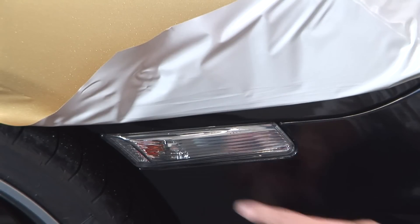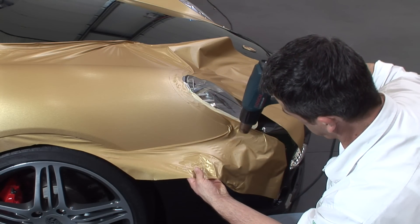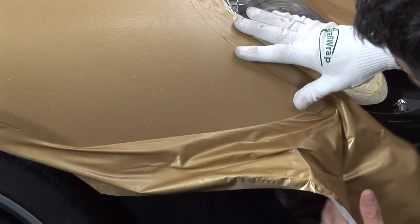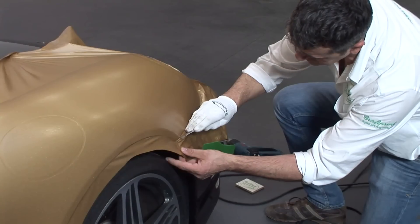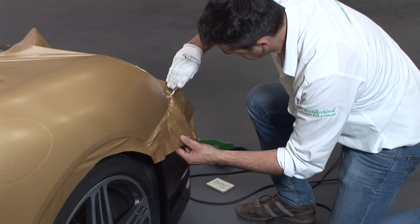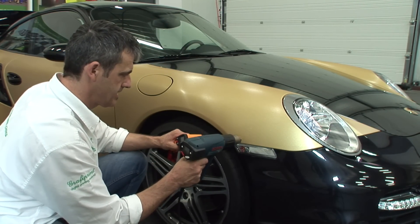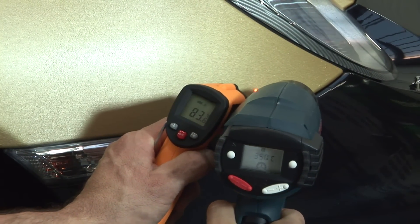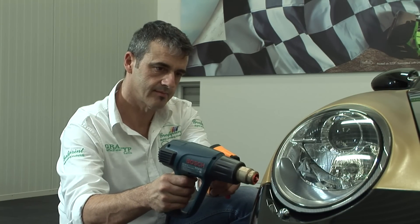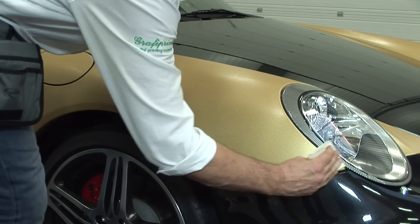If the film has been stretched in the areas where you are going to cut, it is very important to remove all tension in these areas. Pull the stretched film away over the last few centimeters and heat it until it shrinks to its original shape again. Then apply the film again and press it firmly. You can then cut off the surplus film and press it down once again. Once you have applied the film, reheat it once again at 350 degrees Celsius on the display of your heat gun — especially important in areas where the film is under tension and has been stretched in deep indents. This temperature corresponds to about 90 degrees on the film. Then wait for a moment until the film has cooled down and rub it down firmly once again.